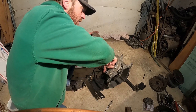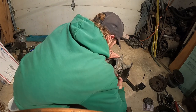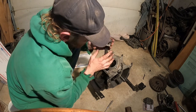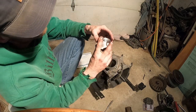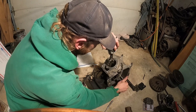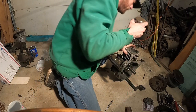And when you get done honing it, after you clean it, you should spray just a shot of WD-40 or something down it. That helps prevent any rusting or whatever. I'll get a little further down in here with some of this. There we go. Good. Now, it also doesn't hurt to add a little bit of oil on everything, because it might be a while till I get around to starting this, and the more everything has some lube, the better. Put the crank part up, slightly down. This is going to want to slide. Try not to scrape your cylinder as you go down with the rod banging around. If you tip it straight, you go down better.